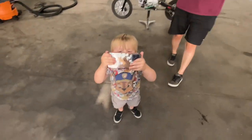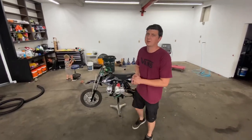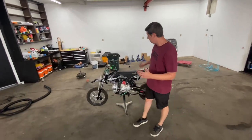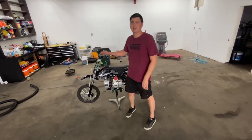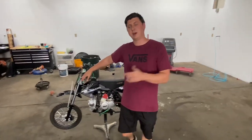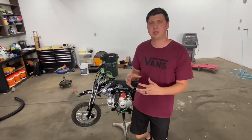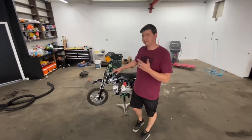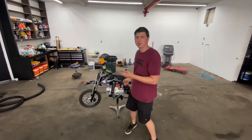This is our second carburetor. It's been a couple months since I rode it, so first of all I'm going to start up that air compressor, put some air into these tires, and get started. The first thing to know is the common issue a lot of people have when they first get their Mikuni carburetors or knockoff Mikuni carburetors — a lot of times they have a little bit of metal from the machining, so you're going to have to take them apart and clean the jets out.